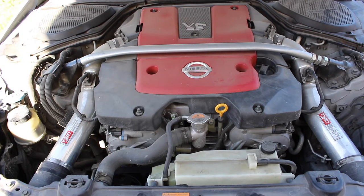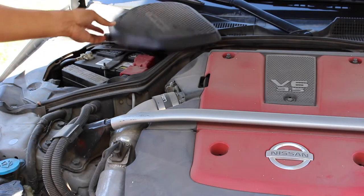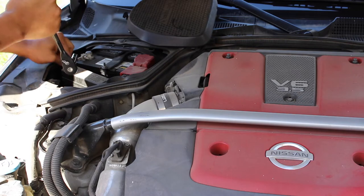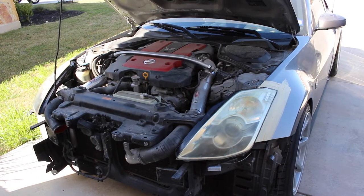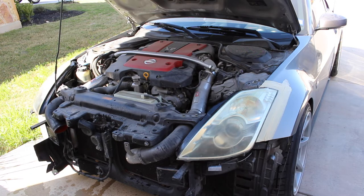The first thing I'm gonna do — like the video I linked, which is from ChrisFix, who made an engine bay car wash video on three different vehicles — is unhook the battery. Also, I'm not going to be using a pressure washer at all because I don't want a lot of water power on this stuff. I'm just going to use my hose with a hose attachment, and then I'm going to use the engine degreaser to spray everything.